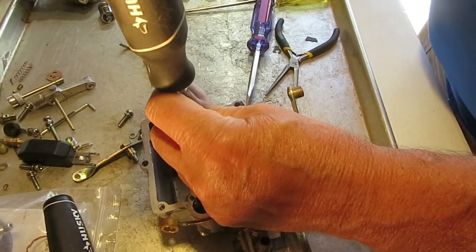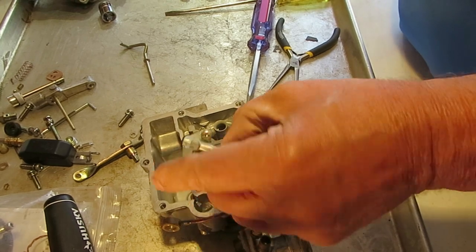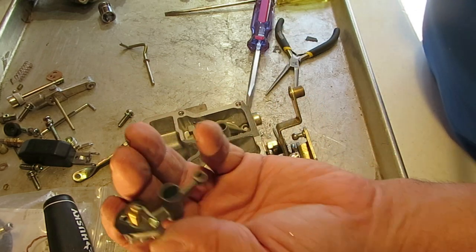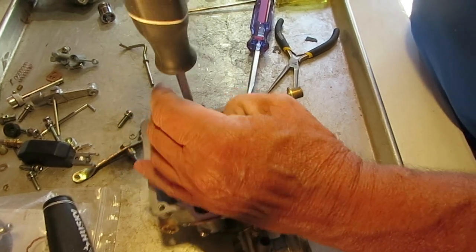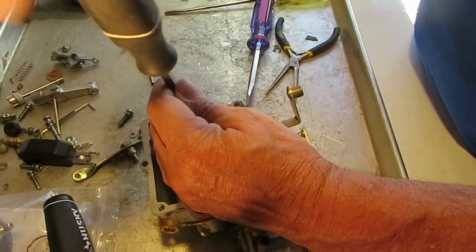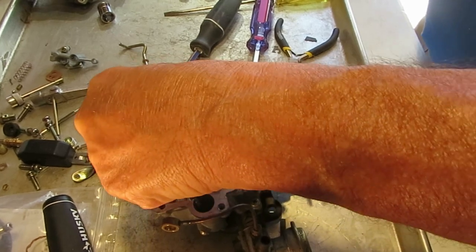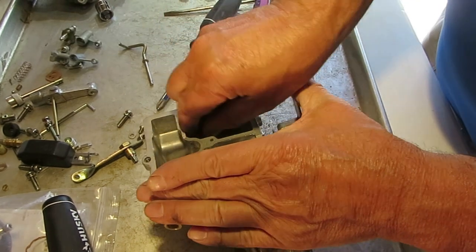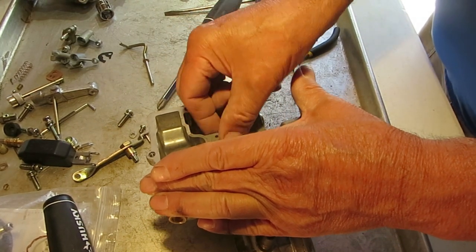Keep in mind when you have two of anything, note which side they go on. There's your emulsion tube, and there's a gasket right there. That's the primary — the primary and secondary can't be mixed up; they'll only go one way. As with most carburetors, you can see that one won't go down in there, so the primary and secondary are not interchangeable. Be sure all the old gasket material is off so it's not holding something up when you reassemble.